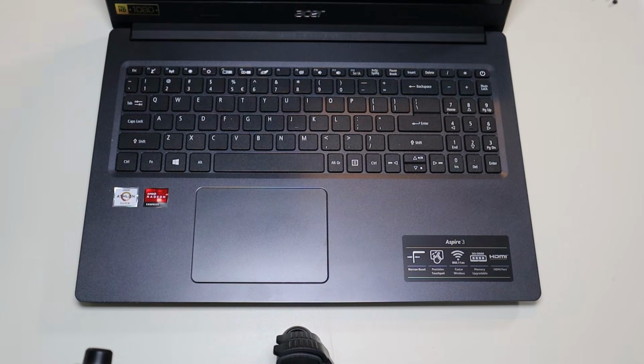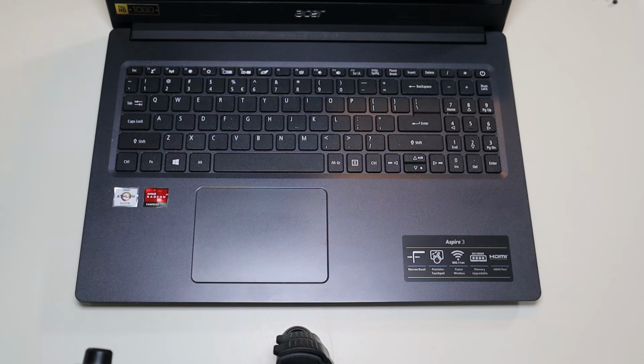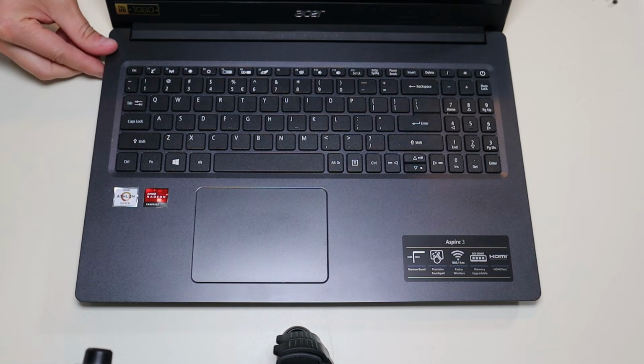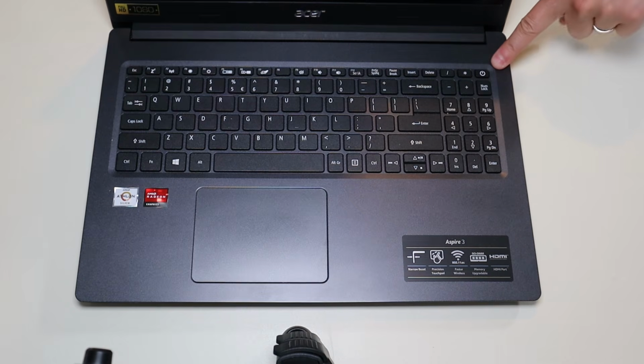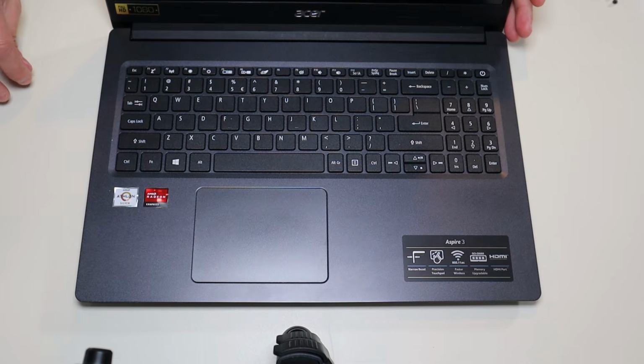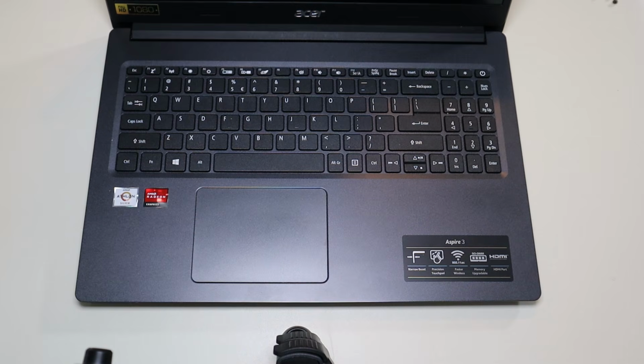After you're done with that, we're going to plug both of them back in, plug your charger back in, put your battery back in, and see if the computer turns on. If not, then we're going to test them one at a time. We're going to unplug the charger again, remove your battery again, and press and hold the power button for 1 whole minute again. After that, we're going to put one of them back. So you can plug in your charger, leave your battery out, and try turning on your computer. If that works, your battery may be failing, and you may want to replace it.